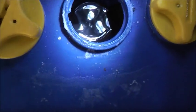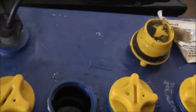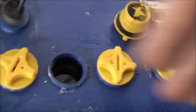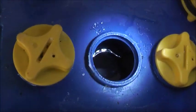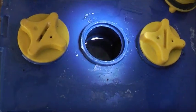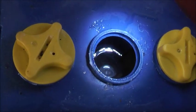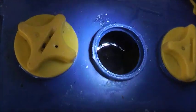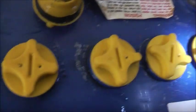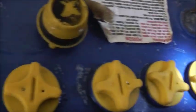We've got bubbles coming out — the batch is revived. Don't touch that one there, as I said, because that's the positive plate. The brown one underneath is our negative plate — that's where you want to force the electrons through, between the separators of the plate, to give the cell a kick. And sure enough, it's revived. Before it was holding 0.8 volts, but now it's close to being fully charged. Look at it going heaps now — it must be balance charging with all the other cells, and this cell is getting more charge as the others are approaching full.